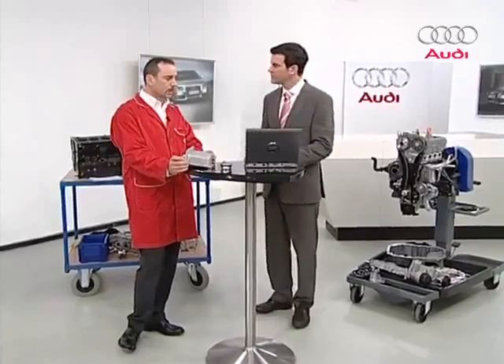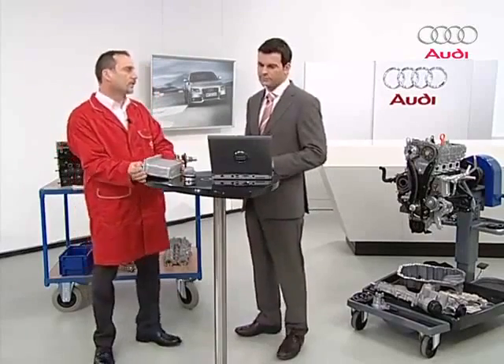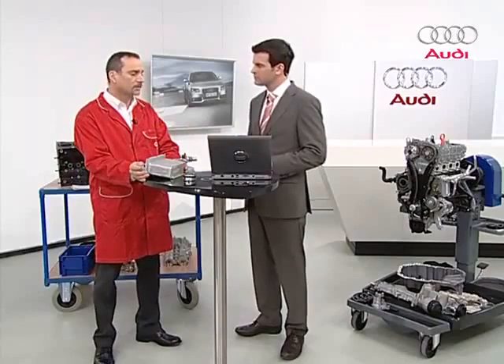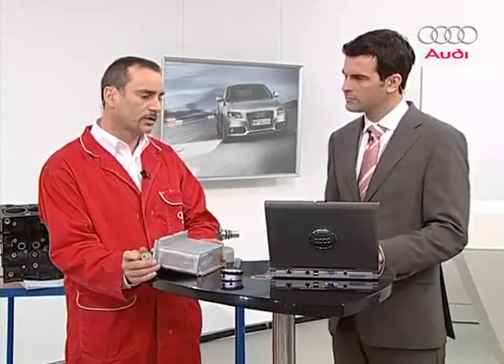What does AVS mean? AVS stands for Audi Valve Lift System — a system of sliding cam units, a variable valve adjustment system. Every V6 engine is equipped with it, including the 2.8 and 3.2-liter engines, and we'll be introducing it in the new 2.0-liter 4-cylinder with chain drive. Next: does the oil pump regulator work less efficiently due to oil deposits? There's a coarse screen filter in front of the oil pump to keep grime out, and the oil filter handles other particles. We test these engines over a long period of time, and we've never had problems of that sort.